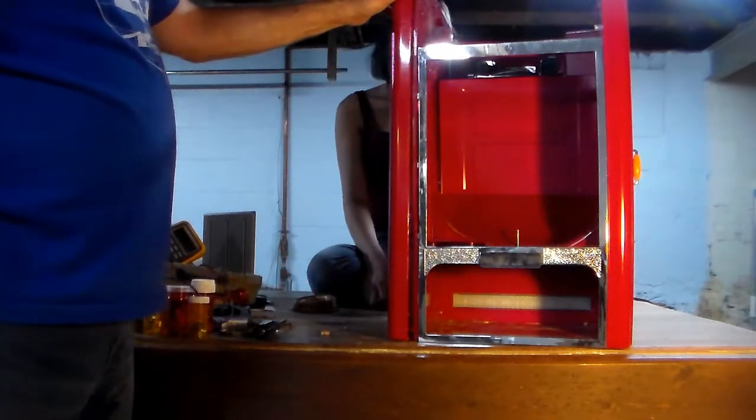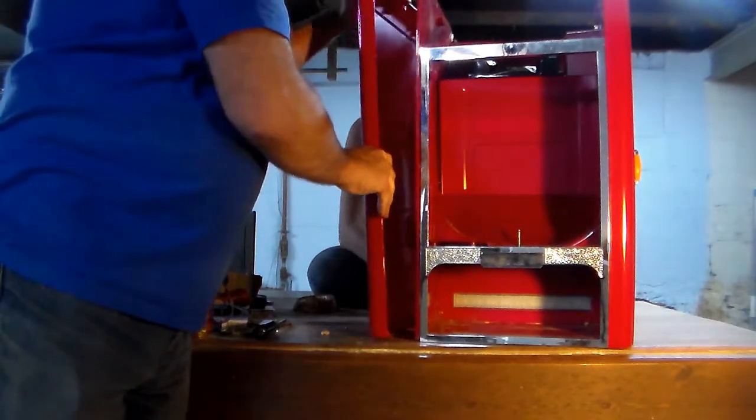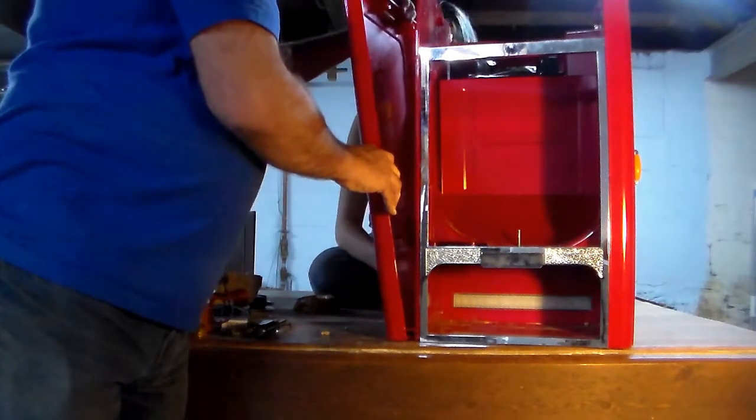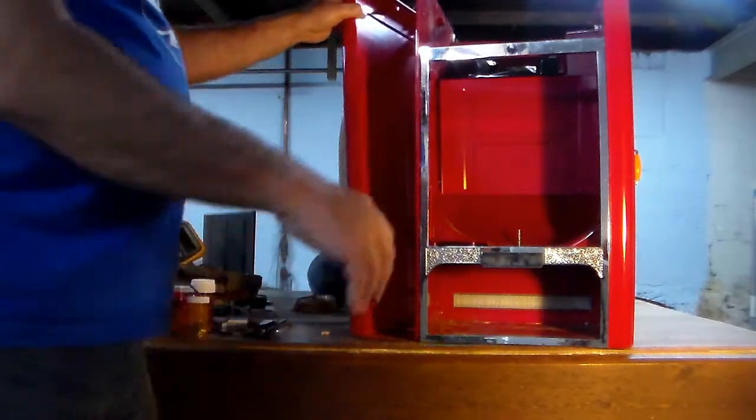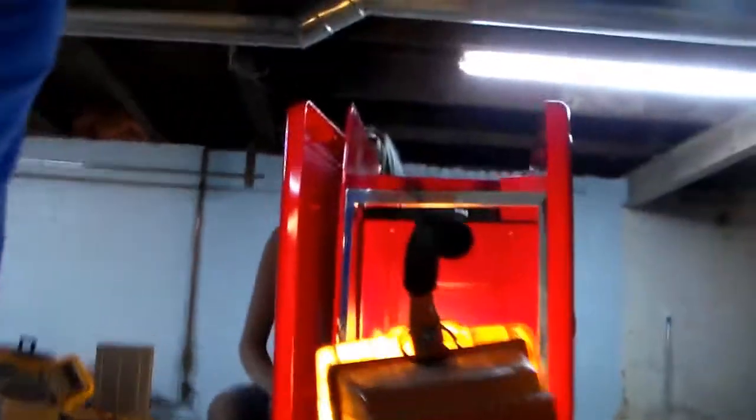We continued and took out every screw imaginable — some we couldn't even see — and I think we're ready to pull the panel away now. I'm going to get some lighting on this and get the camera in here so you can see what we're doing. Inside here, that's a circuit board attached to the activation switch for the blower — we want to get that off next. That's probably where we're going to find our issue. The little black switch right above it is the on-off power switch. So we're going to see if we can get that circuit board out.